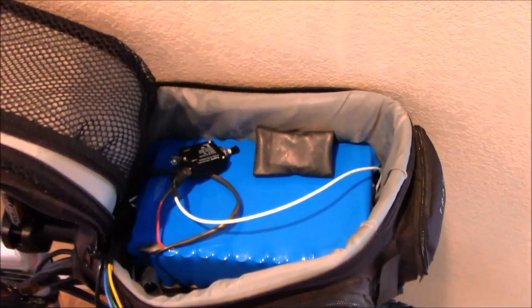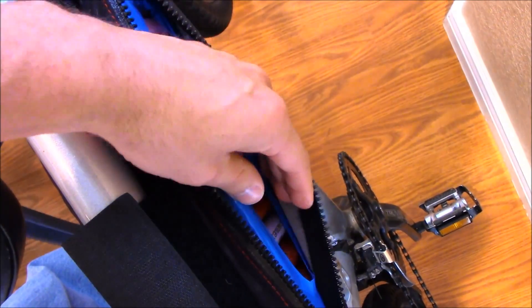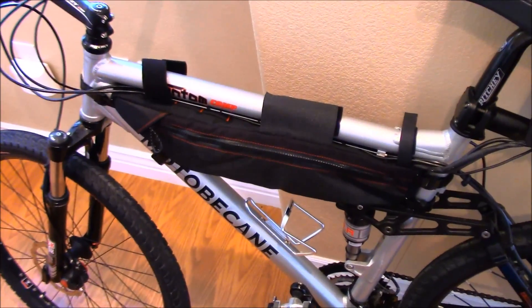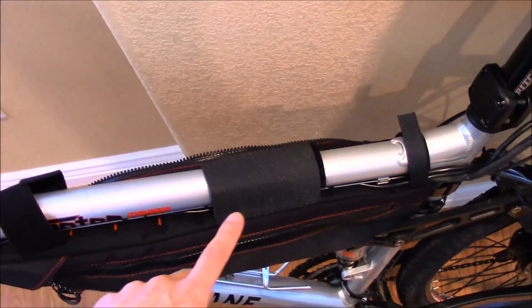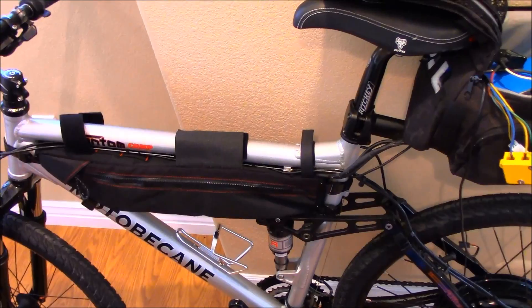You can see my phase wiring and my circuit breaker. There's something new under the top bar — a new battery pack. I completed seven more banks to make it a 20S battery setup. The battery is split into two areas: 13 banks in the back, and seven more banks up front. These newer cells are actually a little bit better, so I'm a little higher than before — I think it was around 17.6 amp hours, and now I'm closer to 19 amp hours with these cells.